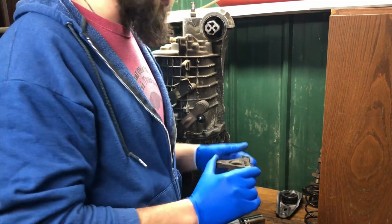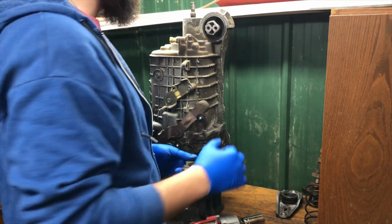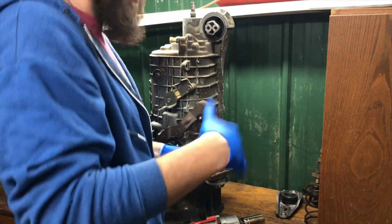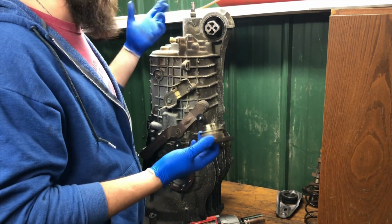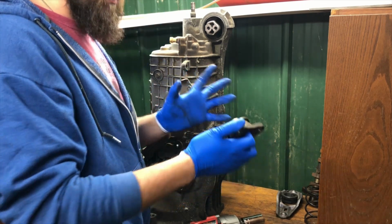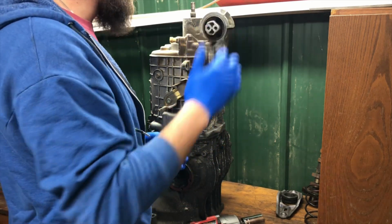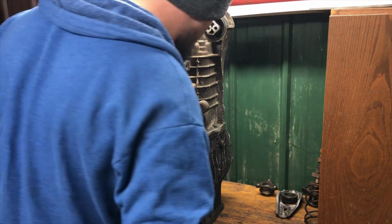Right away, I just realized just like with axle bolts, what I usually do when I don't know the exact torque of them, I will mark with a Sharpie where they were, the orientation of the bolt, and I forgot to do that. And actually, it looks like it just tightens up against the shaft, so I don't think it matters for this bolt the same way it does an axle bolt, of course, when you're holding like a wheel bearing assembly together. So in this case, it's just holding this flange up against this shaft. Now it's time to go around and just take these 13 mils out.